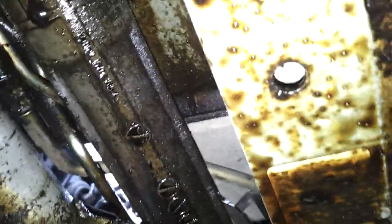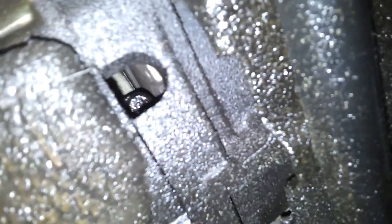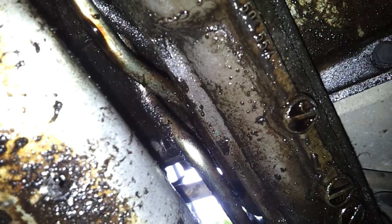The distance from my finger in here — the front of the steering rack to the face of the bell housing — is about 250mm. The sump only goes back this far as far as our piece of cross member material here. Our big motor goes from the bell housing interface and it goes all the way up to 440mm to the commutator end of the motor, which puts it somewhere just in front of the steering rack — giving us a potential problem that the motor is going to bang off the steering rack when we go to install our new drivetrain.